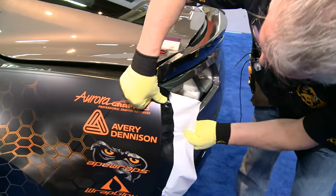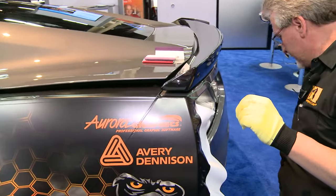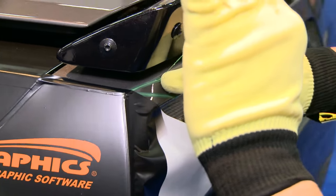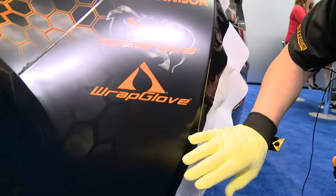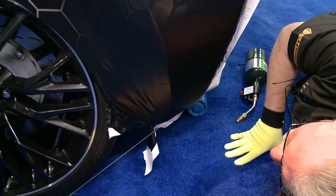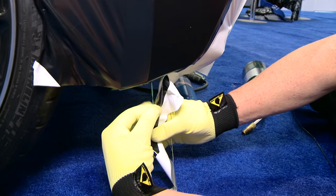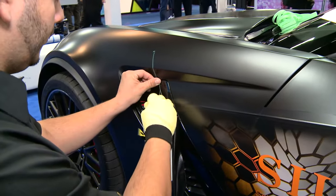What we're doing is defining this edge — it's right on the beauty line of the car right here. We're going to prepare to do the cutting tape. This is the knifeless tape that we're using here — this allows us not to cut on the car. What we'll do is take the filament that's in here, which is Kevlar, line it up, make sure it's lined up, pressure right at the point, and reveal the Kevlar cutting tape. We're going to get real close to the graphic and pull it through, and follow it all the way down — no angles or anything, stay right on top of your line. It's now cut through the material and we're actually taking the other half out from underneath. We're going to do the same thing on the top using the cutting tape to reveal that perfect line for the beauty line.